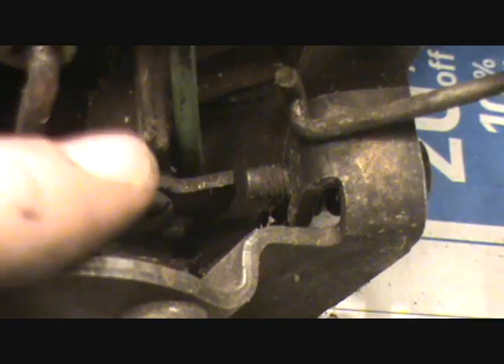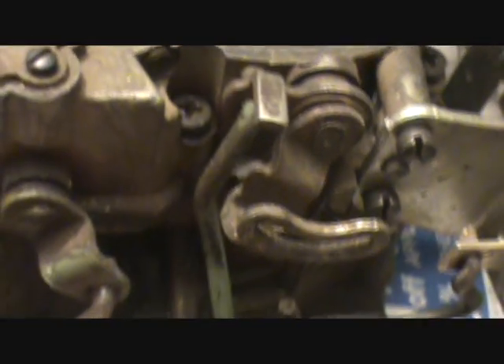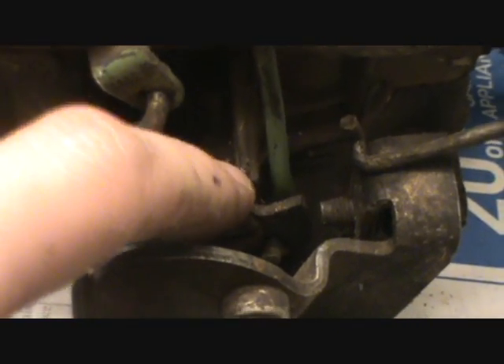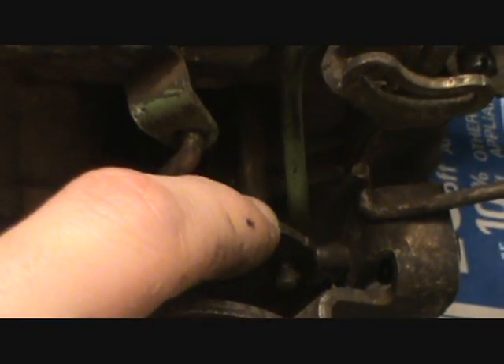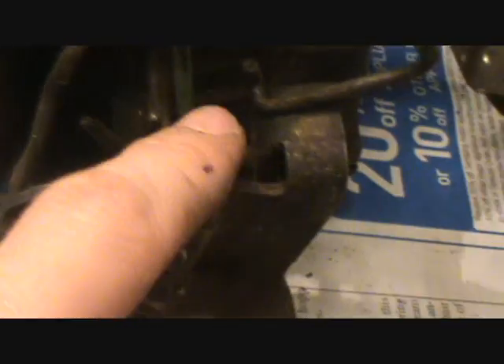This 2G over here has got a different version. It kind of simplified everything — it just uses one screw. As you can see, this would be acting on the choke plate. The choke plate's all the way closed, so it's going to be riding on the highest step — that would be fast idle. Then as the choke plate starts to open, it comes down to the next step, comes down to the next step. And then this would be the base idle position. See how it would be up, then down, then down to the bottom. That's a pretty ingenious design right there.